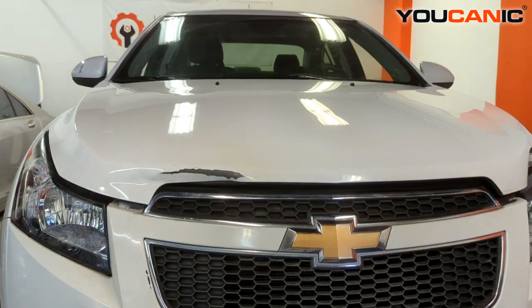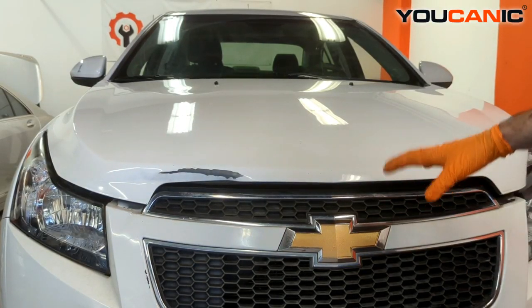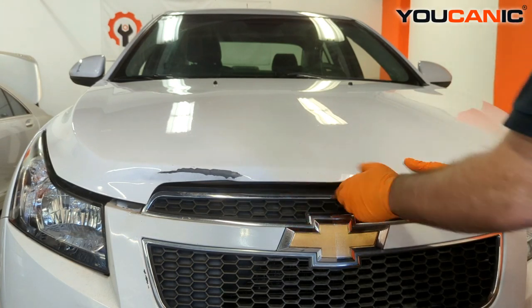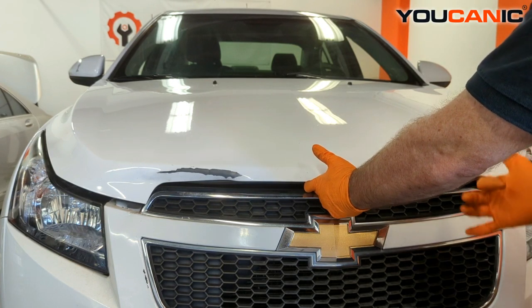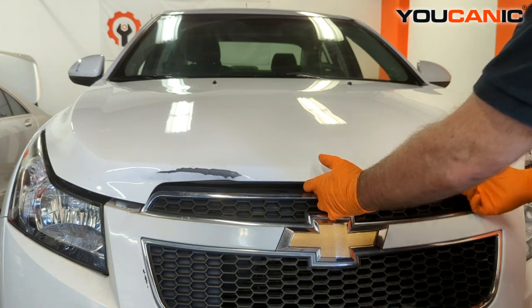Around here at the front of the vehicle, once you pull that lever it pops the hood up so that you get past the first safety latch. Then we've got our secondary latch in here, so we need to reach our hand in right above the emblem — there's the lever — and we're going to take it to our right as we're looking at the vehicle, or to the left of the vehicle if you're sitting in the seat.